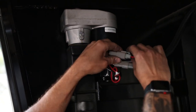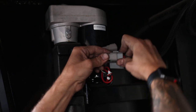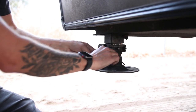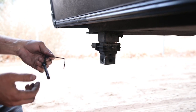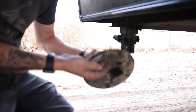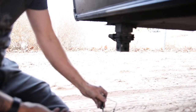Now we're going to disconnect our two electrical quick connects — just press down on the little plastic tab and they pull right apart. Next, prep the jack for removal by removing the foot first. Pull the pin across and out, and the foot will fall to the ground. Save this pin because the new unit comes with a new foot but does not come with this pin, so you have to reuse it.